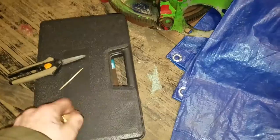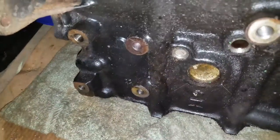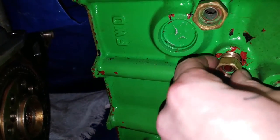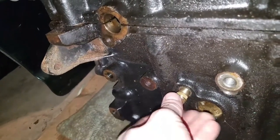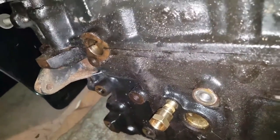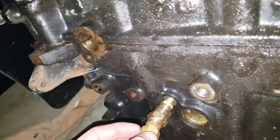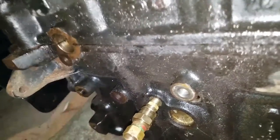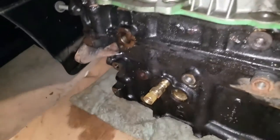I'll show you over here on this other block. Let me turn it flat. Alright so we got our fittings right here — this is how it's going to go. Here's our coolant passage stock on this 2.4 without turbo — that's the one with turbo, it's a lot bigger. So this piece will fit in there. It fits perfectly, but it won't fit in here — you can see it's too small. But this quarter inch will fit in there. That screws in there like so. Take this one, screw it into there, and then screw this into here. We're going to be out there a couple feet, but at least we get to use all the stock lines. And then the other stock line will bolt right into there — that way you can use all the stock coolant lines on a 2.4 turbo. I'll be right back once I get done drilling this out.